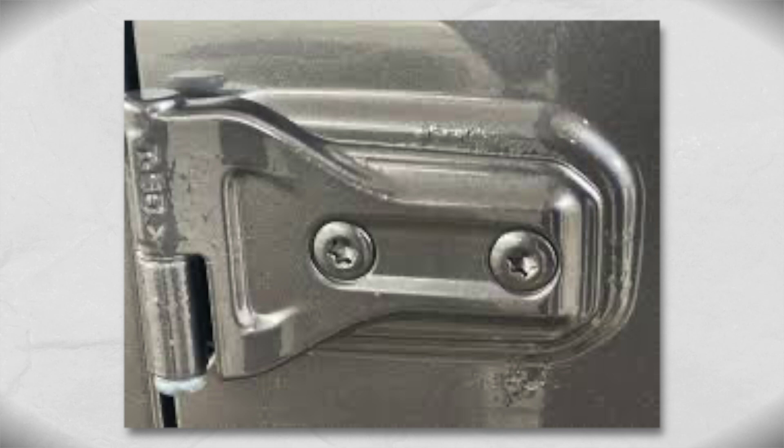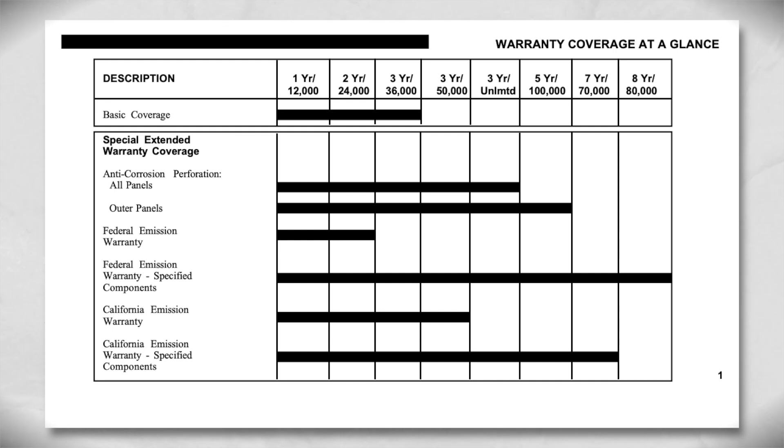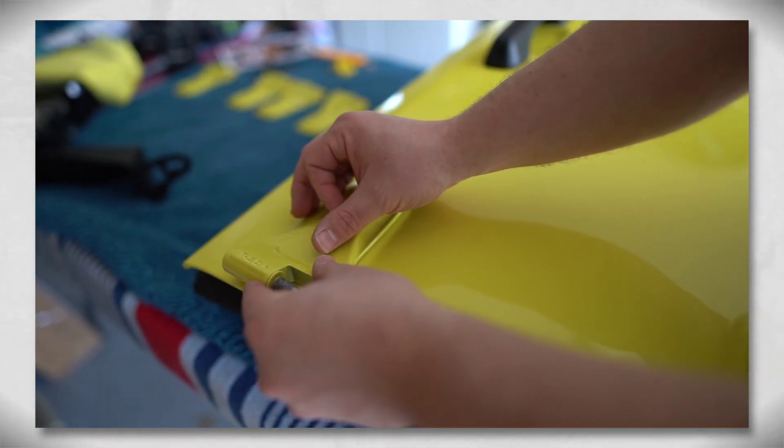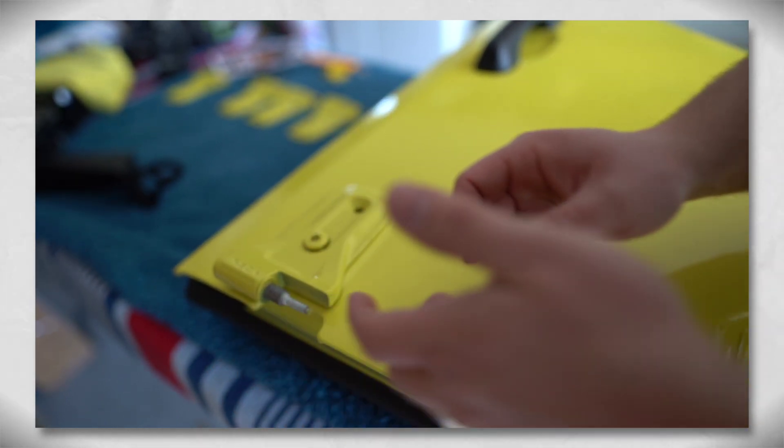What we're seeing in the JLs is a little bit quicker. We have two different types of metal on top of each other, creating that reaction to happen faster than it typically would, which is causing some pitting, some chipping, and then rust can begin to peek in a little bit. Don't fret though — there is an answer, and that is contacting a local dealership that knows exactly what's going on. Do not waste your time with a dealership that has absolutely no idea what you're talking about.